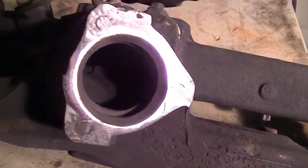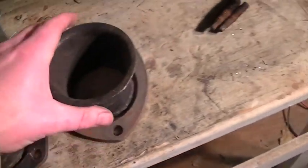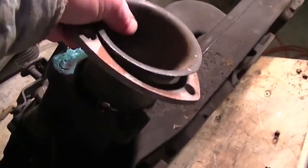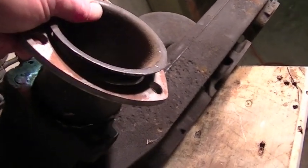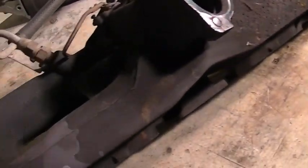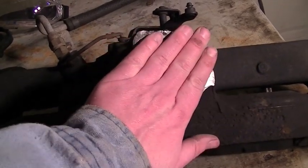What I've done is cut them off and I'm in the process of cleaning up this flange area. I have two header flanges that I cut off of some other project. There's some welding on there I'll grind off. Basically what I'm going to do is weld this header flange to the base of the exhaust manifold, so that I have a much easier way of connecting the manifold to the exhaust pipe. Hopefully it should seal a little bit tighter — I do need to go buy a gasket, but other than that it should be pretty good.